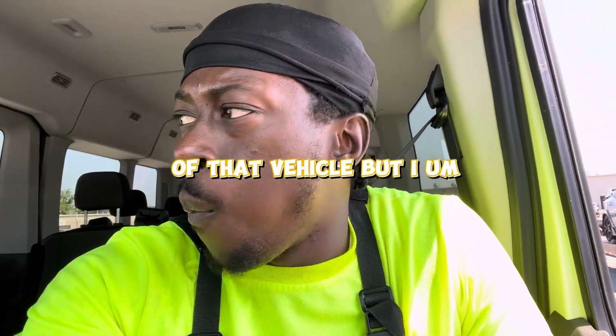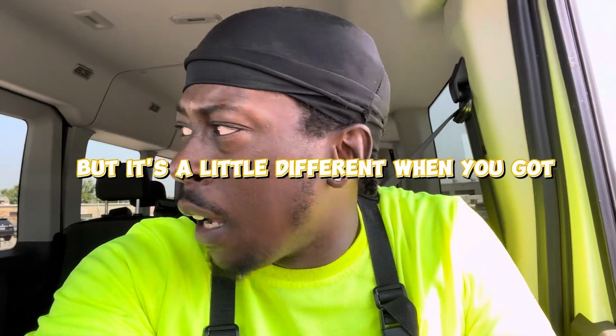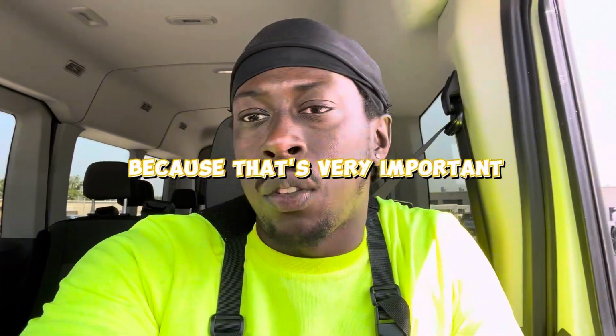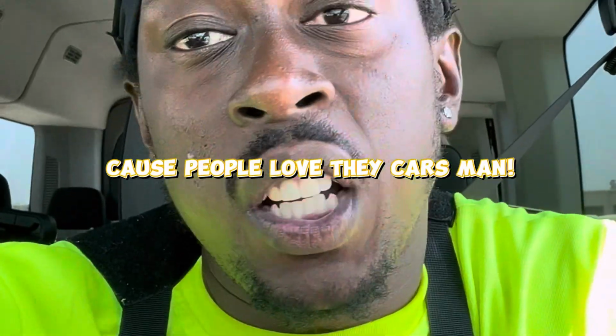But I just forgot to do it because I was more so worried about not damaging the customer's vehicle. And he was standing right there watching me the whole time. Not that I would damage a vehicle, but it's a little different when you got an audience. You got to make sure you're doing it right. And at the same time, I had my nephew with me, so I was trying to teach him the right thing. But I didn't want to leave that part out because that's very important. Make sure that you get you some boards. That way, these lower cars can compensate for the clearance, so you won't be scratching people's cars. People love their cars, man.